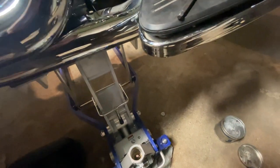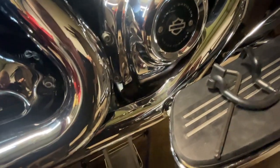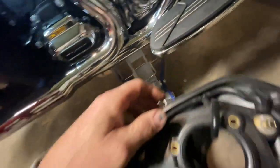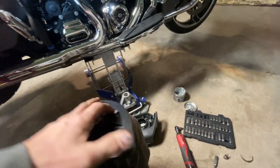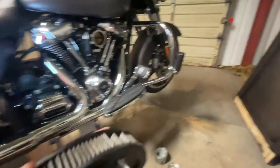This is for crankcase blow-by. What people are doing is hooking up a couple of hoses to the output of the oil up here, on this air cleaner. There are these bolts here — there's a hole in them so the oil goes into them, then into this system, and down this tube, and gets sucked into the intake. My intake is full of oil from that blow-by, which basically burns and gets on top of your pistons. My air filter is also pretty full of oil.